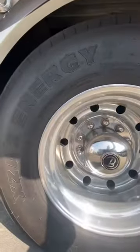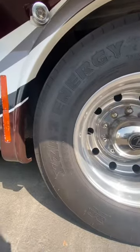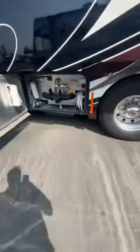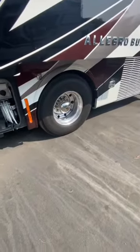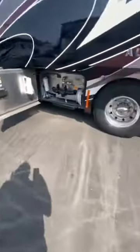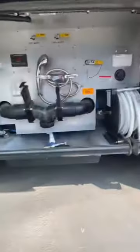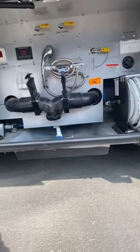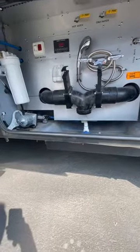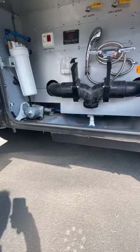Here's another tire — can I find a date code on this one? We do look into that stuff and make sure the tires are in great shape. The rule is that we replace them if they're five years or older, regardless of condition. If this is an 2018, there's probably a 2017 date code, which puts them at around three and a half to four and a quarter years old. I'm always willing to ask if they'll throw in a set of tires so you get a fresh set when putting together an offer.